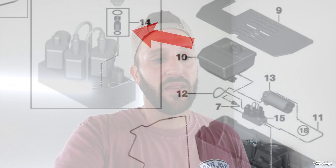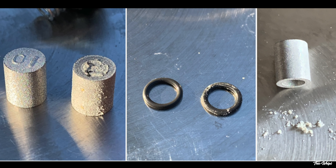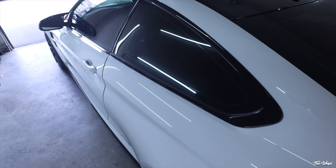After pulling all that stuff out, we're going to hop into replacing the stone filter in the water injection system of the M4 GTS. As I talked about in a previous video, one of the common issues with these cars is replacing the stone filter, which can corrode and calcify over time, leading to blockage in the water injection system. I didn't see a ton of information out there on this topic, so I looked it up on ISTA, got all the tech information I needed to do this DIY at home — and it's pretty simple.